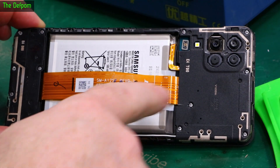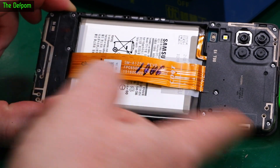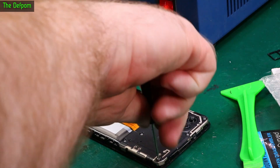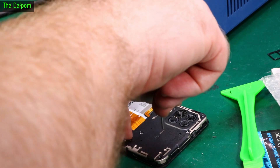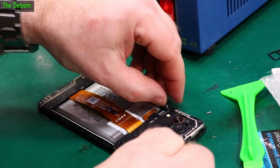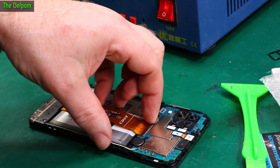There's the inside. We have to remove this cover here, disconnect the battery, disconnect the screen, and remove this other cover. This is the screen flex - one of them - and there's another flex under here. Got to take all these screws out, then pop these off and start getting the screen off. The first thing I'm going to do is disconnect the battery - it's always a wise thing to do. I'll use these little cheap screwdrivers that come with the screen replacement kit. Sometimes they're actually not too bad, but I'll switch to a proper screwdriver - that'll be easier.